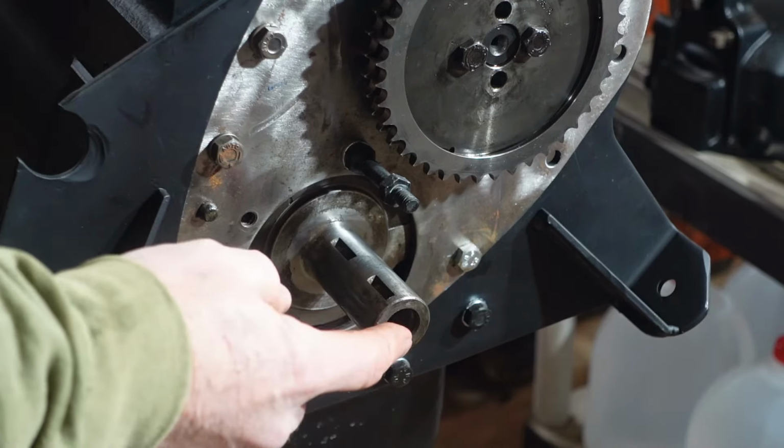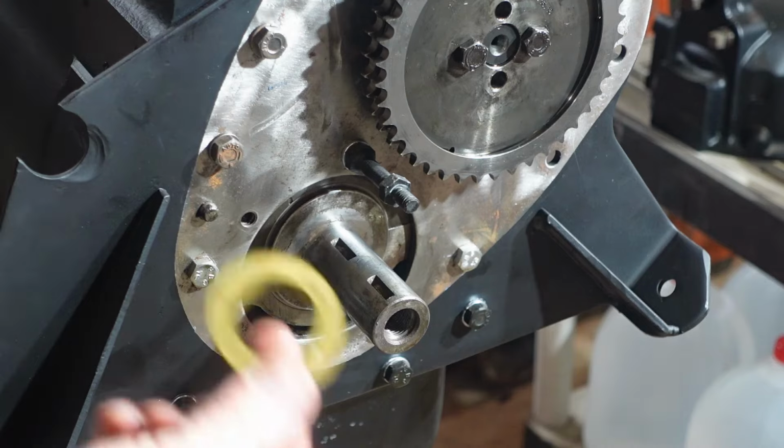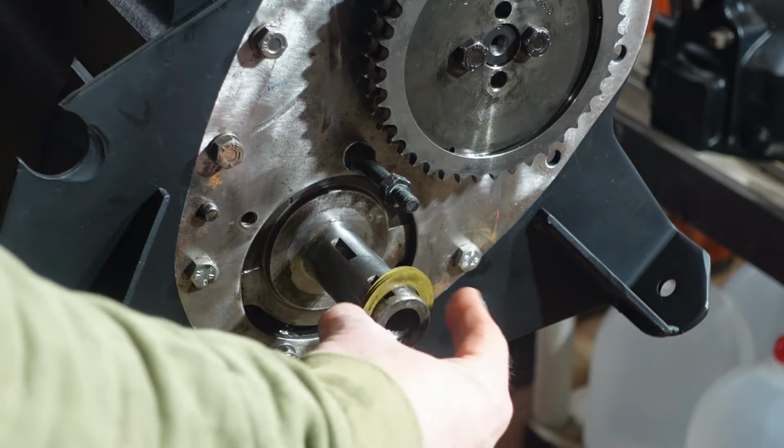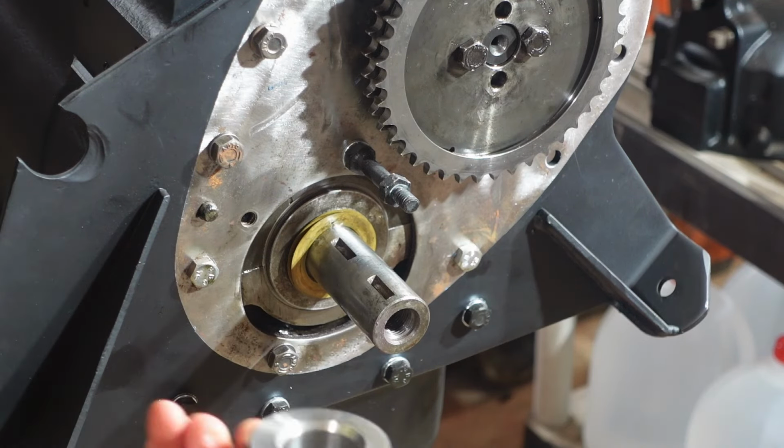So now I've gotta get the gear for the timing chain onto the crankshaft. So there's spacers that are involved with that. The car came with three of them. So I'm gonna put those back on. I'm putting the same gear back on. Essentially the crankshaft's no different. I don't really expect any of this to change. And essentially what we're gonna do is we're trying to align the camshaft gear to the crankshaft gear for the valve train so that it's not cattywampus and it doesn't impose, you know, forces in the wrong way and everything like that. While I would key this, I'll show you that when I get to that point.